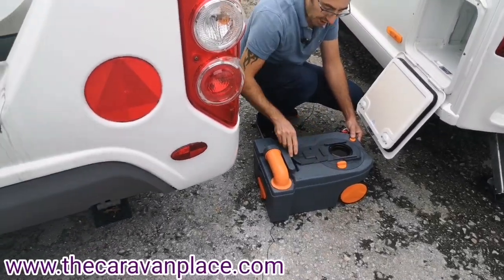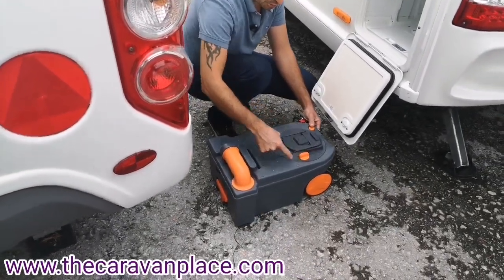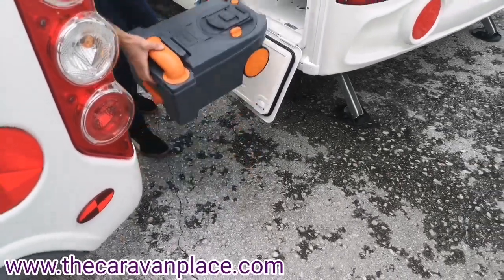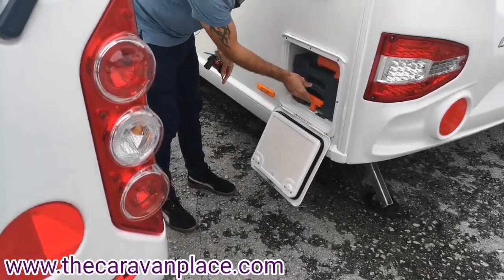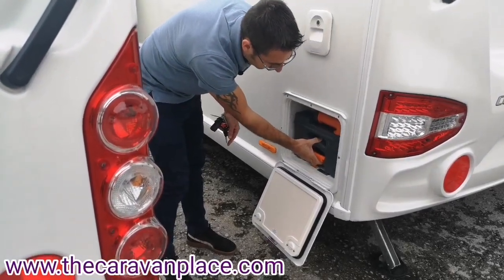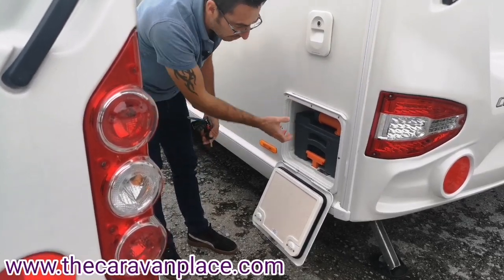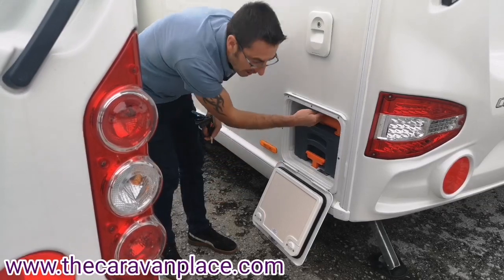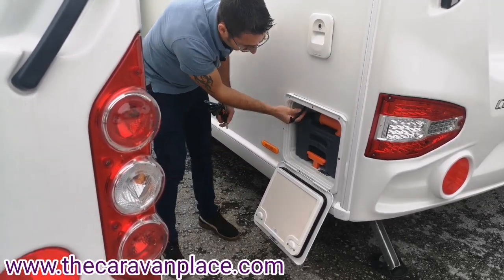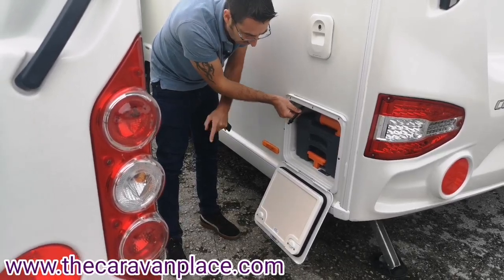Again, we must make sure that that's closed and that is in the forward to back position, and that will slide in. Again, if you come to remove this cassette and it's getting to about there and it's gone quite difficult, just make sure that the flap inside is fully closed, otherwise you're going to pull that out and do some damage. For winter and draining off your flush water, we've got the little empty tube. We remove the cap and that will empty out.